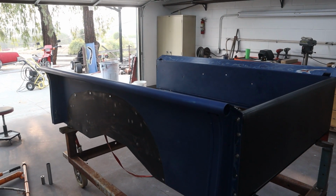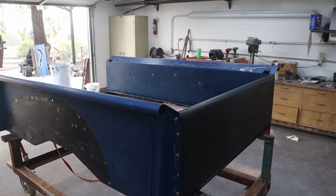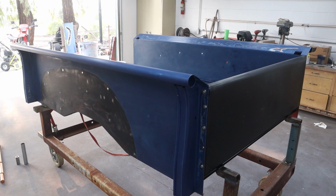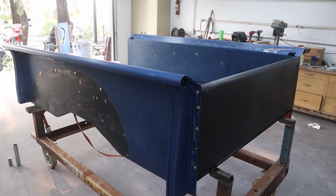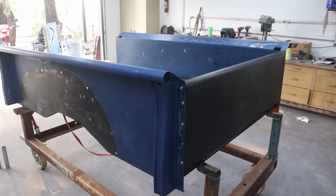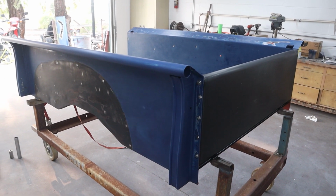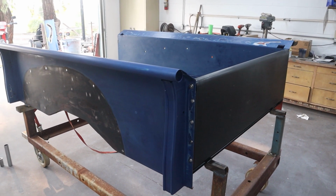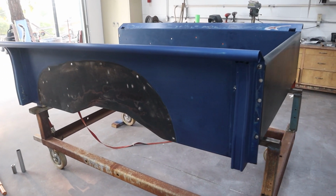It's got some damage to it, but the first thing we really did was roll it outside and mix up some ammonia and some dish soap and some hot water, grabbed a scrubby and just scrubbed this thing 2 or 3 times really well to make sure we got all the wax, grease, dirt, oils, everything off of it, and then pressure washed it 2 or 3 times so it's really clean, ready to go. We shouldn't have to worry about contamination.